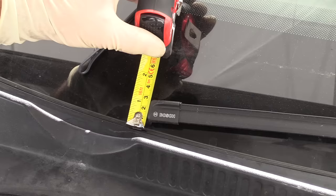In a perfect world, we would follow the repair manual and deactivate alternating park position. What this feature does is it changes the resting position of the wipers, which helps extend the life of your wiper blade. But it's not a perfect world, and if everything worked okay you wouldn't be replacing the wiper motor anyway. I'm going to show you how to do it without all that extra stuff and still get it perfect. I generally mark the current position of the wipers, but ours are very poorly adjusted so we can't use that either.